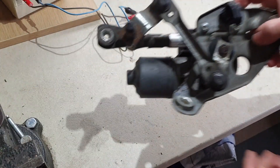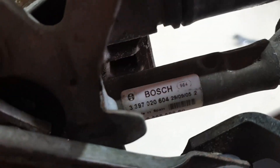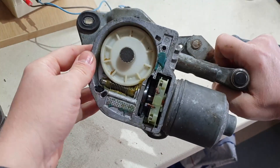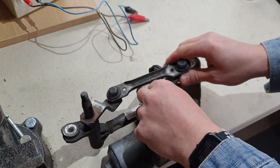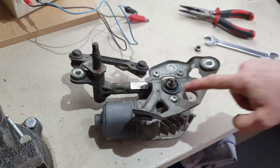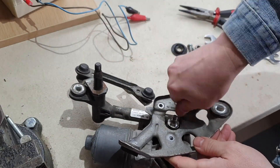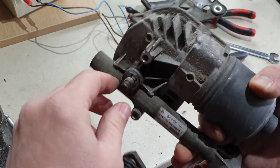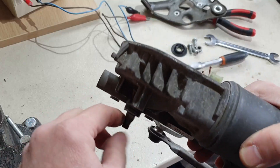Now about motors. This is a car windshield wiper motor from a Peugeot 407, made by Bosch. It's missing its cover. I stripped all the accessories. Because this big reduction gear is made out of plastic, it's a bad idea to weld this shaft — the heat will destroy the plastic gear.